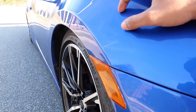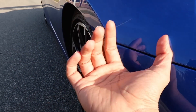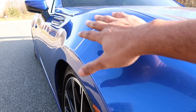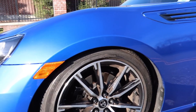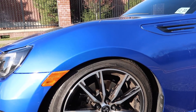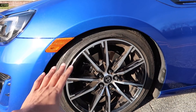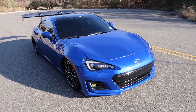The reason why I have stock wheels on right now is because my wheels actually have too high of an offset and they actually touch the back. So what I'm going to need to do is run a spacer to make the wheels stick out a little bit more, and I'm also going to need something else soon to make the wheels fit. The reason why the front is so much higher than the back is simply because I didn't adjust the coil on the backs — this is pretty much the setting they give it at. Obviously I'm going to have to adjust it, but I'll wait until I get my proper wheels back on.